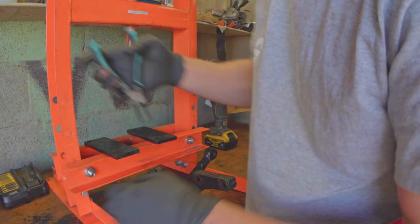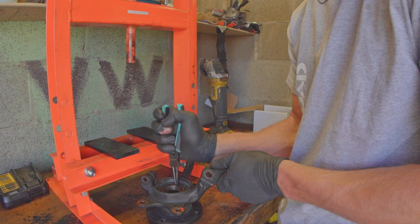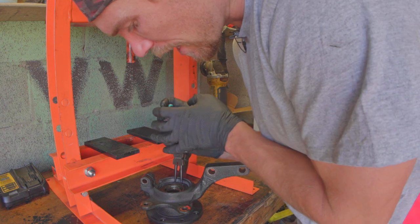Just got to figure out how to get this set up so we're actually pressing the right object, because if you do it wrong you're just putting the load right back into the assembly — that's kind of the tricky part about pressing things. Take the snap ring out — that's always a good first step. I'm about done with snap rings after doing my transmission.